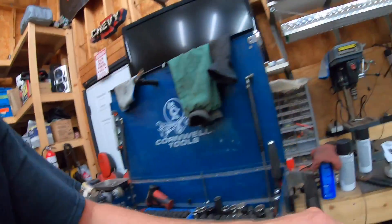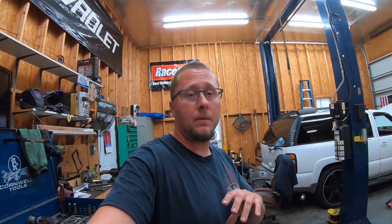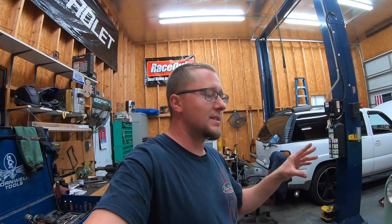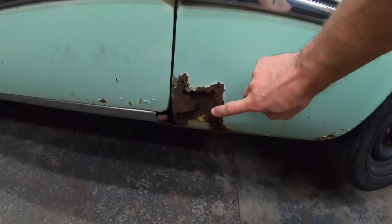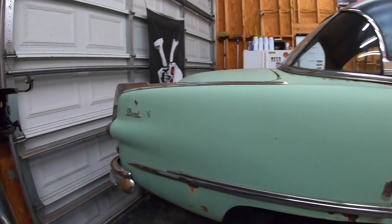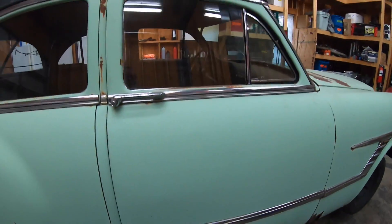I have not put coolant in it yet because the water neck on top of the cylinder head is leaking. I have a solution for that - I have this fabricated water neck that I'm going to modify to hold a new style thermostat, and it should mount right to the top of the head. Once I can let it run for five or ten minutes on its own without overheating, the entire wiring harness is coming out of the car and I'm going to wire this thing for 12 volts. Once the car has been wired and the body is structurally sound, I'm going to start doing the fun stuff - bagging it, putting the wheels on it. The interior is going to be one of the last things I do. I am going to patch this rust here, but the rest of the car is going to stay like it is for now.